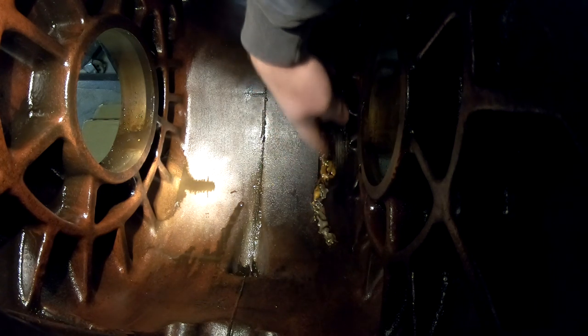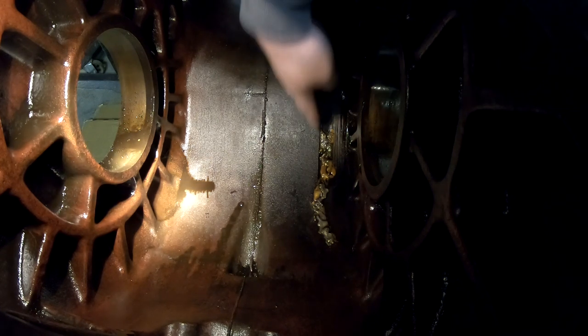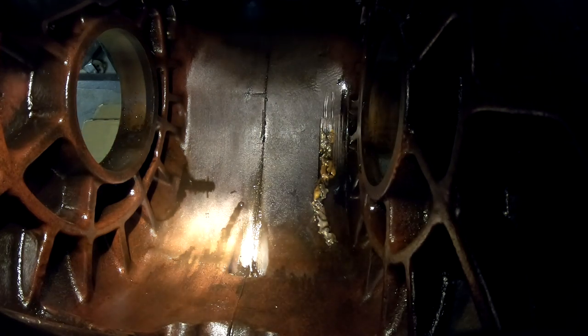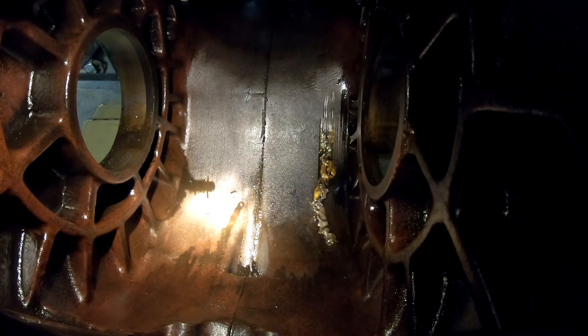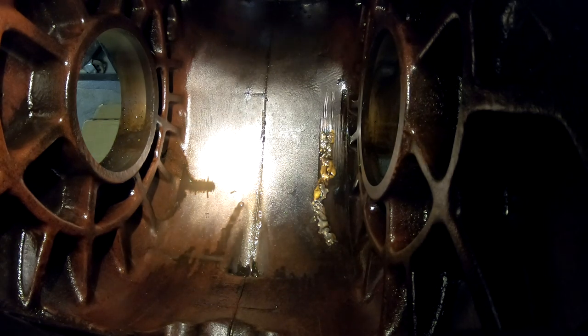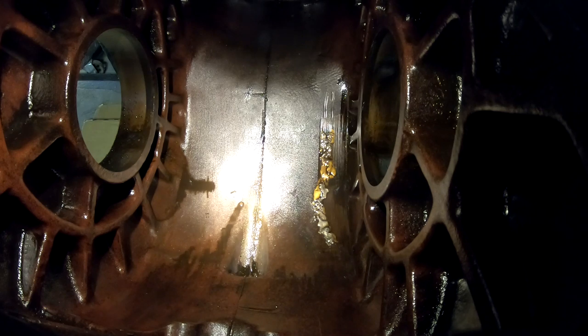and actually bust the bottom of the case out, because the bull gear and all the rotating parts are a lot stronger than the bottom of the casting. So it'll just push those balls right through the bottom. And that's the result. So when you're looking at H's and M's, make sure you check the bottom of the casings in the back for holes or welds or cracks, because it's a really common problem. But I've got some feelers out to get a different case for this, and it's really not going to be too awful expensive, which is good.